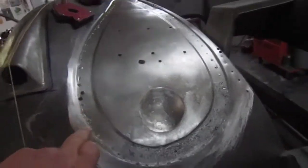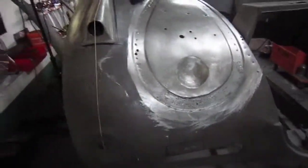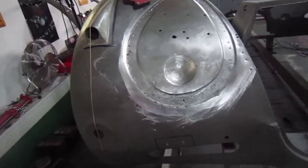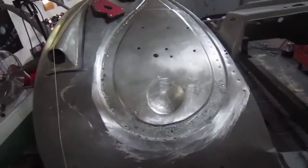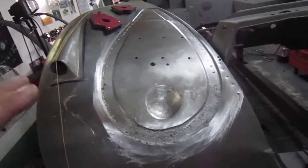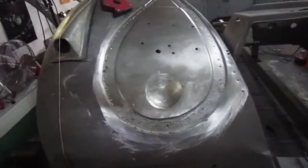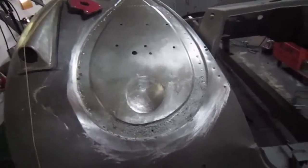All the rust was underneath here, which has been taken off now. There was no rust where — somebody mentioned about the flux for the lead loading. That's true, it should be neutralized. But when you're lead loading you do tend to burn most of it off, and they're not as big acid-based etched now as they used to be. Most of this rust is caused because it was bare metal to metal — those light pods were put on there with no primer. It was just sheet steel against sheet steel with nothing underneath it, nothing to protect it. They didn't have weld-through primers in those days. So it's actually the metal-to-metal contact that's where the problem is.